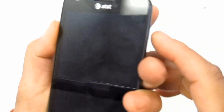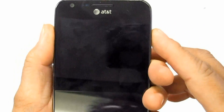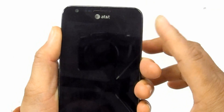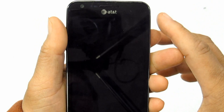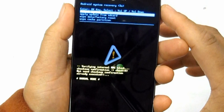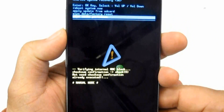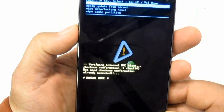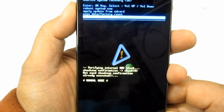Note that the phone will become unrooted if you have already rooted your phone. Press and hold the volume up and home button, then press the power button. Release the power button until the device turns on. Note that other Samsung Galaxy S firmware versions may not work with this button combination — on some it only works with the volume down button and the power button instead of the volume up button.